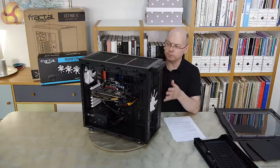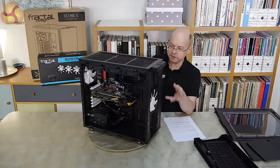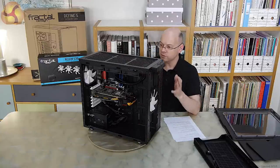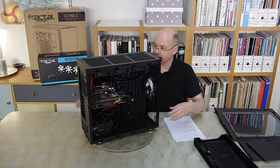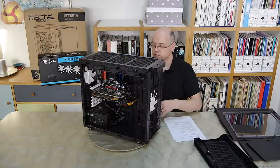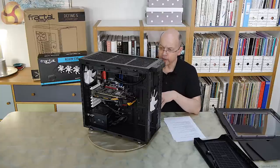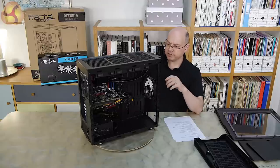You can extend the loop either to add a GPU block or GPU blocks, or alternatively you can have a second radiator in the front to handle your graphics — many options. You can easily add another 360mm radiator in the front simultaneously and still have space. Alternatively, going the air-cooled route gives you three fans at the front, one at the rear, three in the roof, and one in the floor — though that will impact the power supply size. Probably best to focus on top, front, and rear, so whether you go liquid or air it kind of all comes out the same.